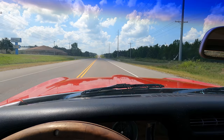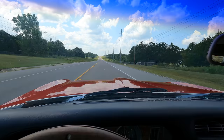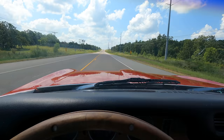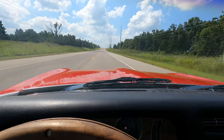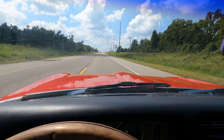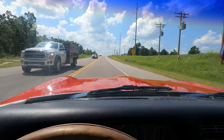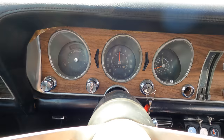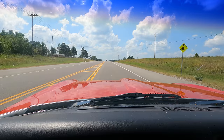I also don't have a working gas gauge, so I have no idea how much fuel I have. Once you get going though, you can floor it and she opens up — but I don't hear the secondaries kicking in. She moves, but from a dead stop she just doesn't take off like she should. All the other gauges look good — temp and oil pressure are fine.